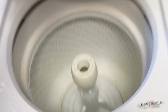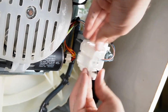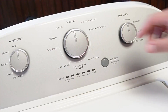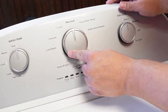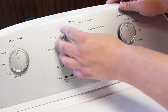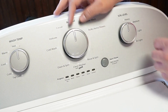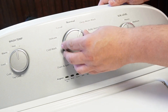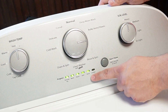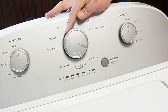Now that we've done the first reset, let's go ahead and attempt to recalibrate this washing machine through the calibration mode. This is a must-do if you've installed any new parts on the washing machine, from a board to a balancing rod. With the washing machine freshly rebooted, rotate the dial counterclockwise 360 degrees. Then turn the knob right three clicks, left once, then right once again. You need to do all these things within three seconds, and it may take a few attempts, but if done right, all the lights at the bottom of the washing machine control should flash on and off, showing that you've entered diagnostic mode.